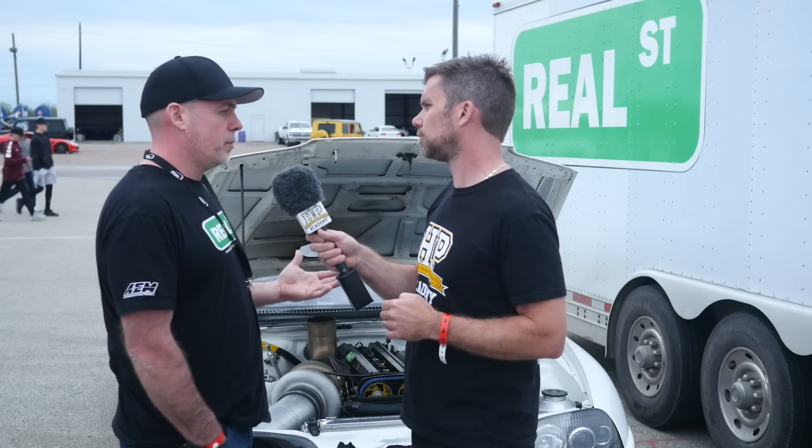The car has trouble keeping the front wheels on the ground, and we're not running wheelie bars. We'd run the car quite a few times at a lower launch power, but yesterday I was greedy — I put a couple more pounds in and it drove up into a wheelie. Then today the boost control actually stopped flowing air to the bottom of the wastegate, so the second run we were 15 or 16 pounds above launch aim. At 38 pounds of boost on the starting line, the 275 tyre still hooked up — so the tyre probably isn't holding this car back too much.